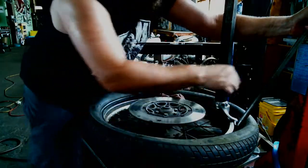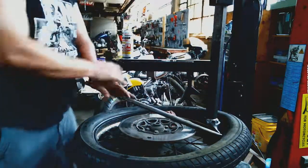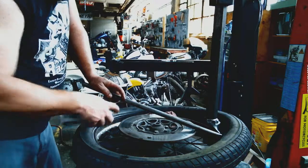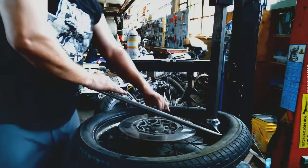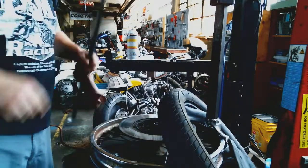Got the tire iron all the way down through to the other side of the bead — the end of the tire iron is actually holding the other bead out. Pull this up and over the edge. We're going to take a little PB Blaster, soapy water, or something like that and give a little spritz down in there. You don't always need this, but on an old tire like this it sure does help. Press the pedal on the far right — and there your tire is off the bead, off the wheel.